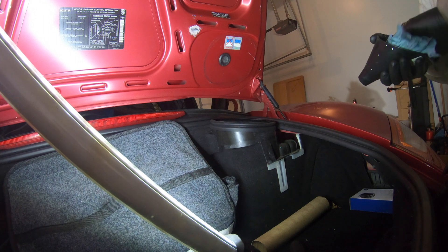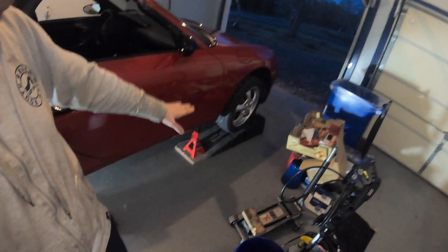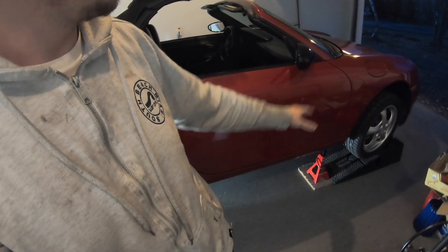This is how you change oil on your 986 Boxster — pretty simple. The only difficult part is you have to actually lift up the car and make it level. That is the difficult part because the car is low, so you need to either have ramps or put some wood under the front tires because the front is lower than the back. The back is easier to lift. I will do a video on how to lift up your Boxster a bit later. I hope you enjoyed — stay tuned because next I'm going to show you how to change the fuel filter, which is more difficult than what we just did. See you next time. Goodbye.